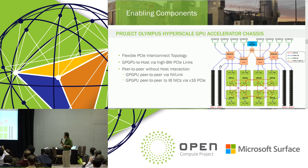In this particular topology, you can see that we're using PCIe switches. Each PCIe switch has 3×16 links dedicated to PCIe slots or GPUs. They have 1×16 link to interconnect to each other as inter-switch links, and they provide 2×16 links to the outside world. At the chassis level, there are 8×16 PCIe links available, and we can connect them to a large host or use them to interconnect multiple chassis together.